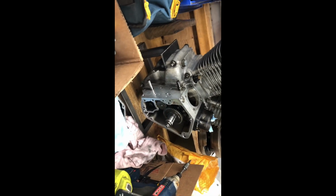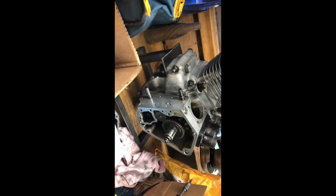So the other thing is to check my oil pressure here. But I took apart the pump, I rebuilt the pump, checked all the gaskets. It's like brand new. There's not a score mark, nothing in it. So yeah, this video is going to be in parts here, but that's where I'm at with the FXR. I'd love to get that bike running right, but I'm not driving it like that. A tappet noise, I don't like it.